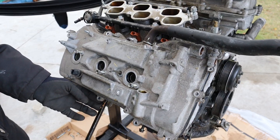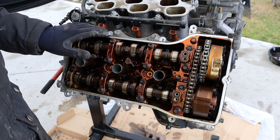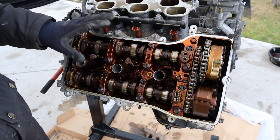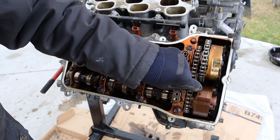I'm going to try not to break anything this time — yeah, I broke it. As you can see under the valve cover, things are pretty tarnished, which means that whoever took care of this didn't change their oil on time and caused the oil to break down a lot. There's also no excessive wear on the camshafts indicating a low oil situation. The timing chains so far look like they're intact.